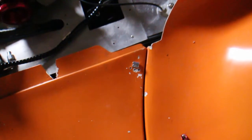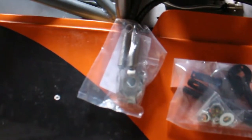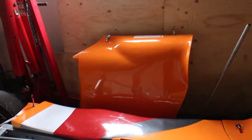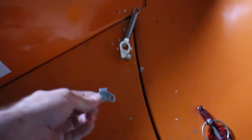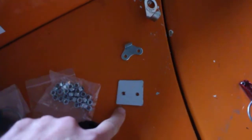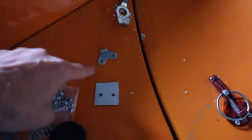I've already had a go at this and completely messed it all up. I've bought a load of clips — springy bonnet clips and some rods. I'm going to put one here, one here, and underneath this bodywork I'm going to put that clip around here. Then underneath the bodywork I'm going to back it with this aluminium piece just to spread the load, because this is quite thin.